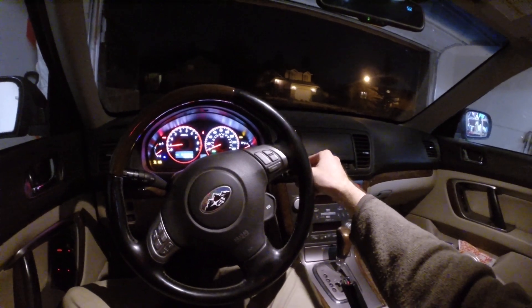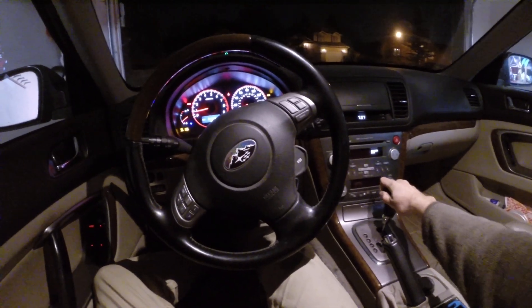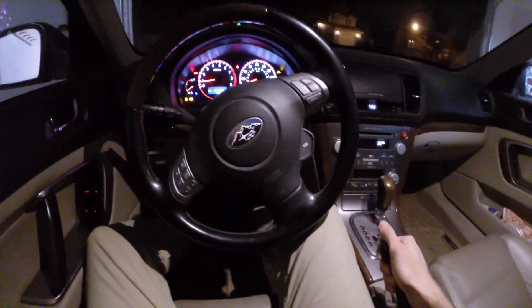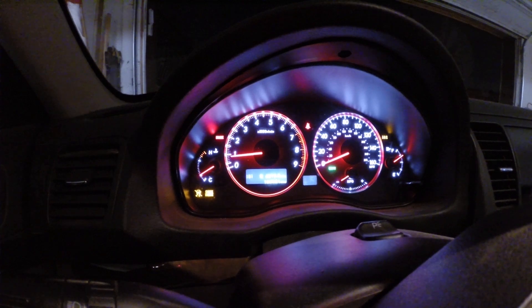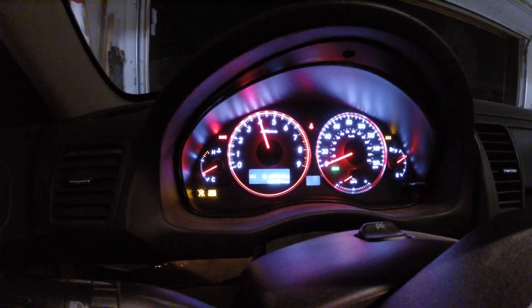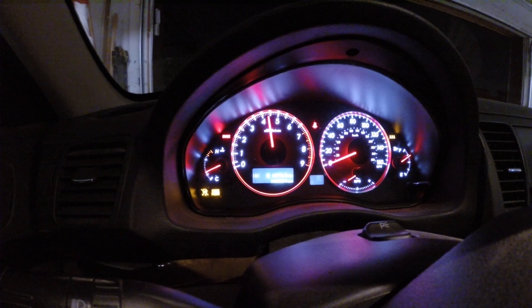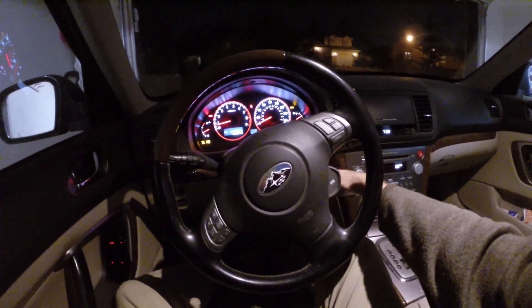Checking one more thing — doesn't seem to affect intermittent rear wipers, which sometimes is affected by reverse, and I can physically take the selector out of park. I am not going to play with that too much without the TCM connected. Seems to run fine. I do have what seems like a rev limiter at four and a half thousand, although it acted a little weird — like it wanted to keep going up, but that's about where it stopped. So there may be something we need to look at there. But everything else looks okay. The car starts, seems to be fine, no issues. So I think that's a successful test.